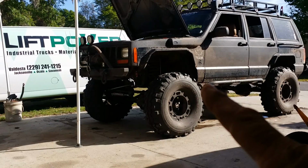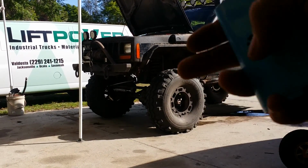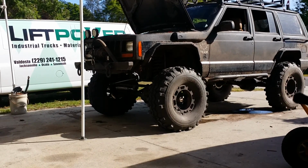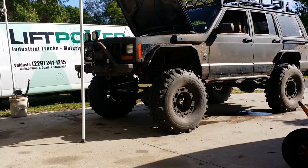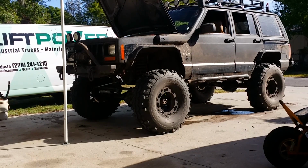I didn't know what the hell to do, you know. Be careful with them winches. Don't wrap your hand around that rope. Try to spool it out, pull it out, hook it up, go back, lock it, and then get away from it when you're pulling on it. I mean, Damien, the guy that hooked me up the first time and the second time at the end there, he's really skilled at it. He's done it a lot.